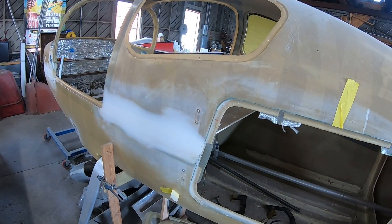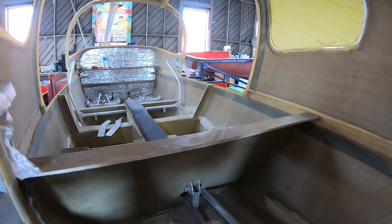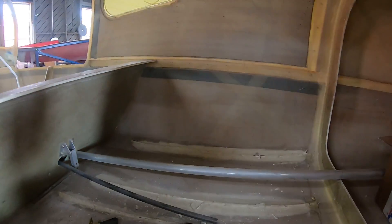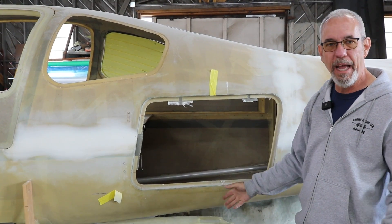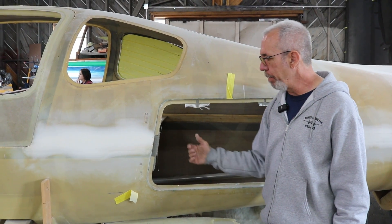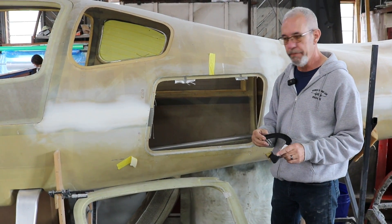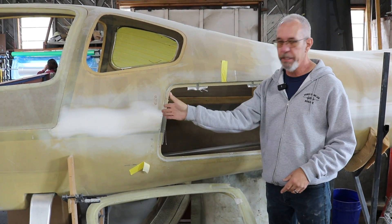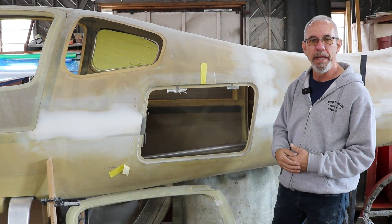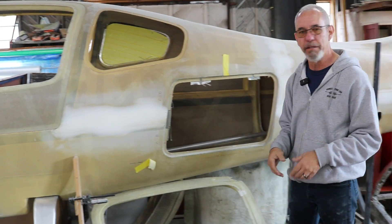The baggage area has a large door, and we're making some modifications. The original design calls for this baggage door to drop straight down on piano hinges. I don't like the piano hinge idea because when you push against that door you fracture the composites, and if anything comes open in flight, it's going to come open. We've all had a baggage door come open in flight. So what we did is use the door hinges that LancAir uses, creating a hinge that allows the door to open outwards. If the door pops open in flight, the air will keep it somewhat closed until you make a safe landing, and your baggage items won't be exiting as you're trying to get back to the ground.